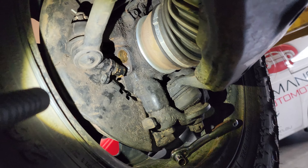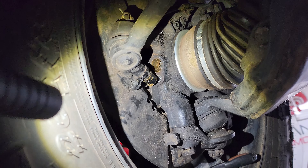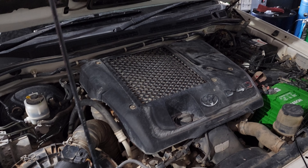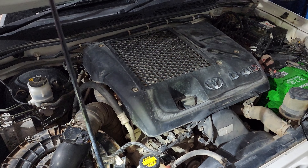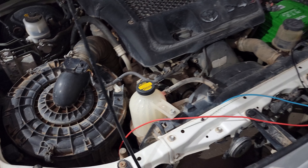It's good, 100%. I'm going to put that back in and then we will double check what's going on with the scope. I've just had a look on the system and these are magneto-resistive sensors, so we're looking for battery voltage on one side, ground on the other side, and they obviously want to see a signal when we're turning the wheel.